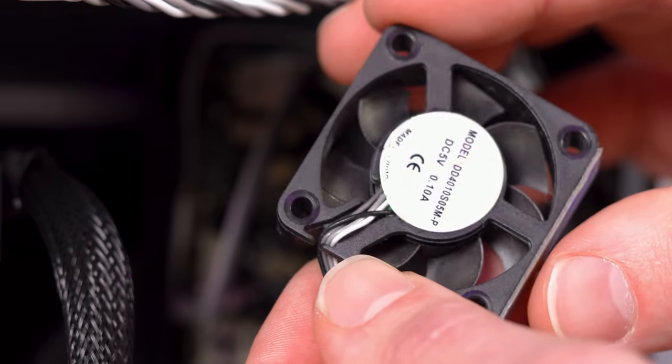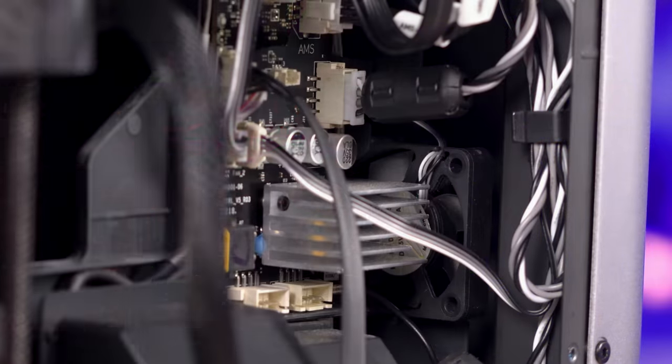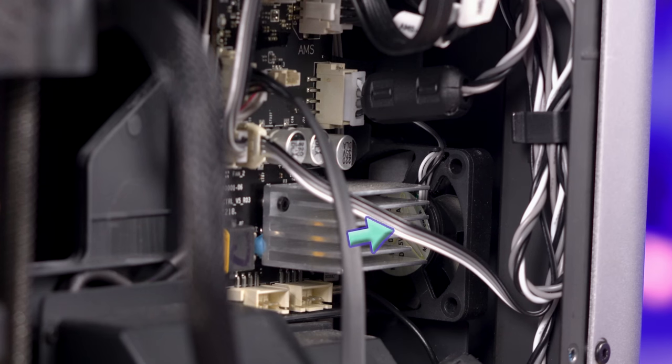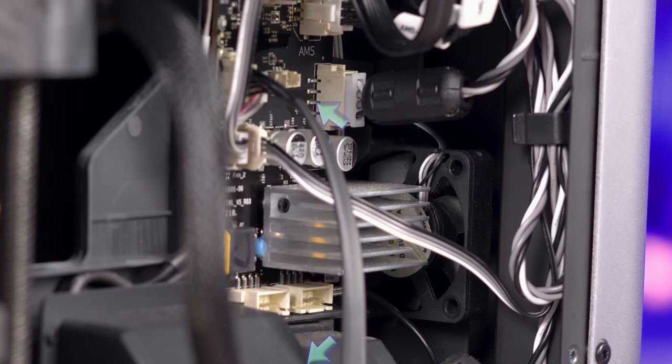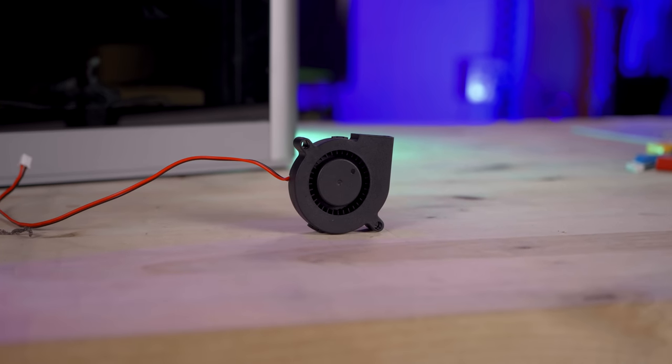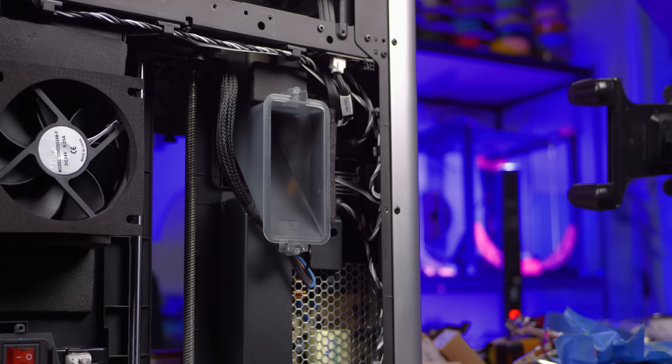I did note that the fan I took out had a weird discoloration and wrinkling on the label, almost like it got overheated, and the new one absolutely didn't look that way. The cooked sticker indicates that fan was getting fairly hot. Looking at how it's installed, the motor center hub of the fan is in line with the heat sink it's supposed to be cooling — but that's not how axial fans blow. They blow in an expanding cone that travels outward from the opening of the fan. If you want to line up a fan with a heat sink, you want something like a blower fan. It seems like the cone of air is bypassing that heat sink entirely, and then the heat sink is heating up and cooking the bearings inside the fan.